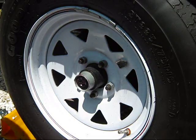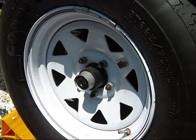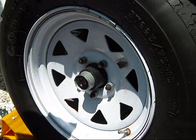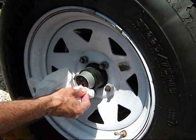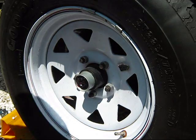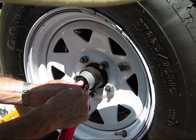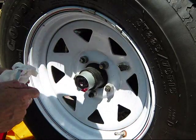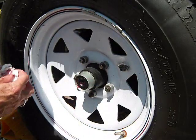I'm sure you're asking how often you should do this. I think it's worth doing once a year, and if you're using your trailer like crazy, do it every 12,000 miles. It's not that big of an operation, and it can save your wheel. One way to test that your bearings are good is by temperature — get yourself one of these little infrared heat guns, you can buy them on Amazon for about 40 bucks. When you're trailering during the day, take the little laser and point it right on the hub to get your temperature.